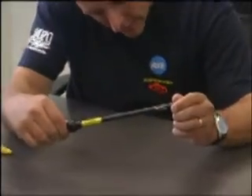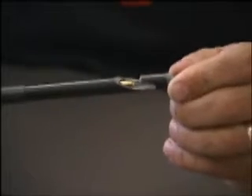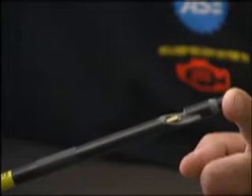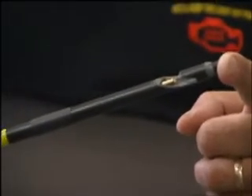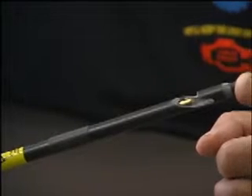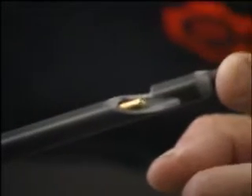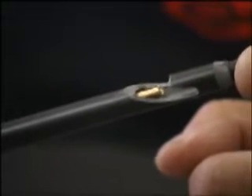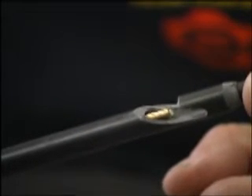I'm going to turn that so you can see better, but you can see the brass shaft there pulls back. It allows you to slip a wire in the slot here. George can zoom in and get the end of that shaft. There are five little piercing needles on the end of that shaft. They're put in there with a special press — they're not soldered — so we can retain the strength of the needles. So you're saying if those needles penetrate into a dry old wire, those needles will pull out with the probe.